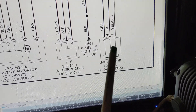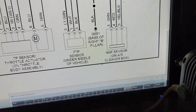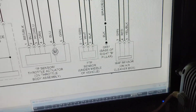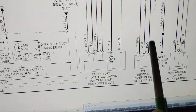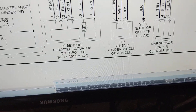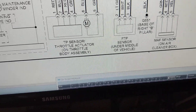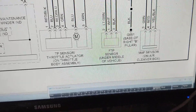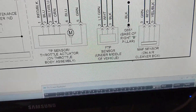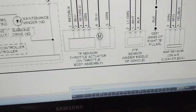I just made a video about the mass airflow sensor. How many wires? One, two, three. One has to be a ground, one has to be 12 volts, one has to be the signal wire — and the signal wire always goes back to the computer. So whenever you see sensors, think automatically: a sensor goes back to the computer. Which computer? The VCM, ECM, PCM — the one that deals with air-fuel ratio. If the sensor has to do with air, it has to do with engine performance, so it goes to the PCM or ECM, not the body control module.